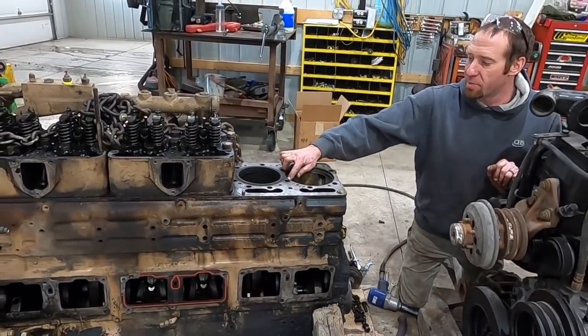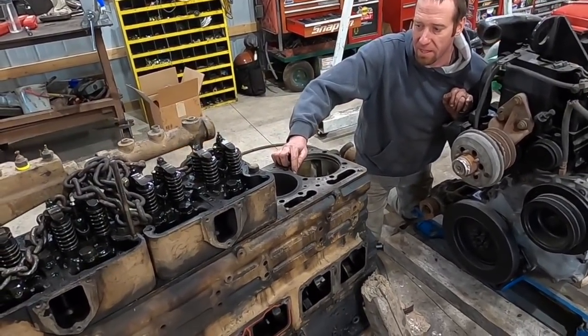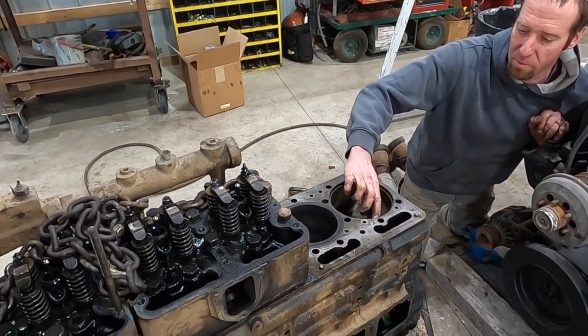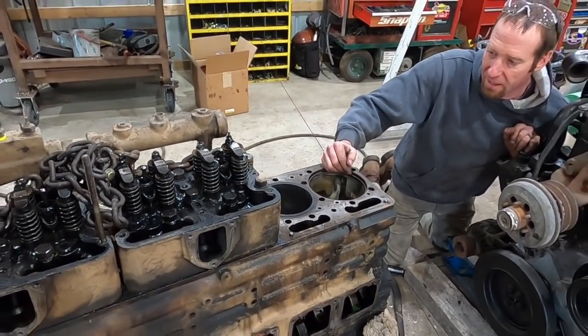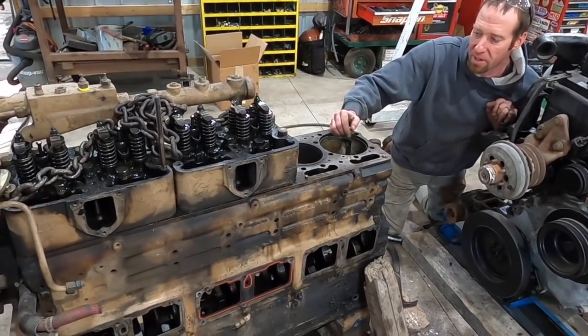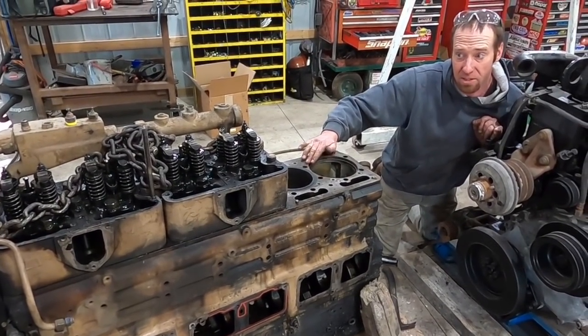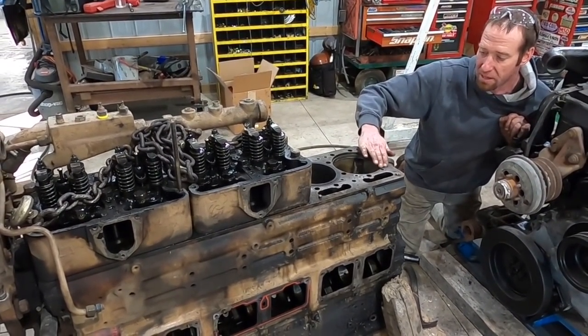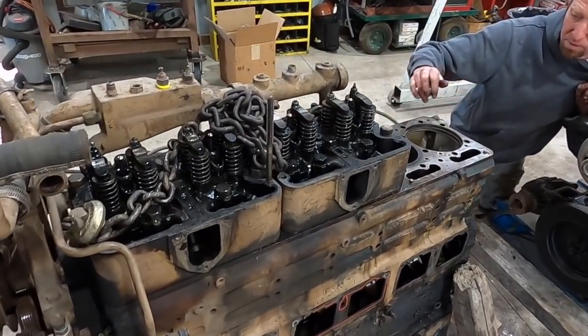Well, we had concerns. We were using coolant. Started using coolant after they replaced the head on it here. Brian did it 6 months ago. And we were figuring that the head had an injector cup go bad. We weren't able to exactly pinpoint it, and there was a lot of cheese whiz up in the top of this block from when we did it a couple years ago. We had a lot of repair sleeving, and head bolt dowels put in too.